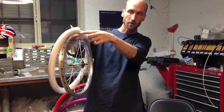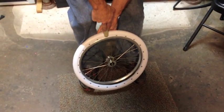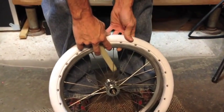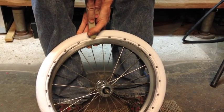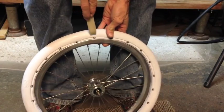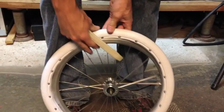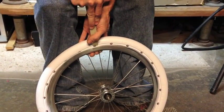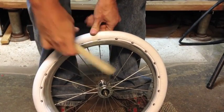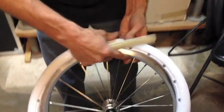So with these, I usually find it's easiest if you kind of angle one side in and then have the other side open. Then if you place it on the ground between your feet, you can kind of rest it against your ankle. You want to use the curved part of the tool toward the outside, and push on the tab, putting pressure as close to the center of the tab as you can — because that's where it's going to flex the easiest — and you're just pushing down until you get a nice snap. If the tire is sticking out a little bit, you can just work it in with the tool as you work your way around. Just make sure that the tabs aren't popping out on the other side, but as long as you're kind of pushing it in place as you go, it should lock right in.